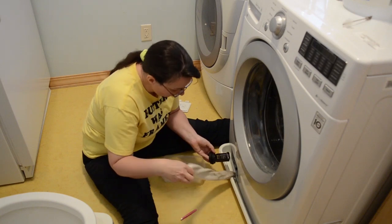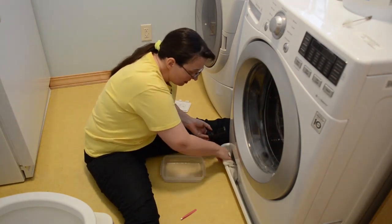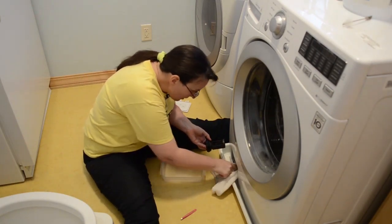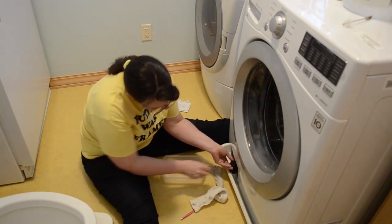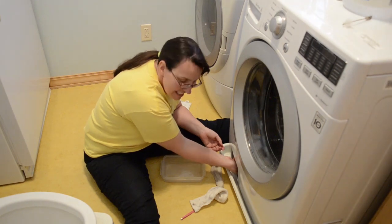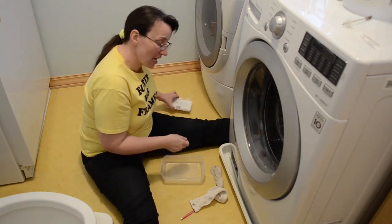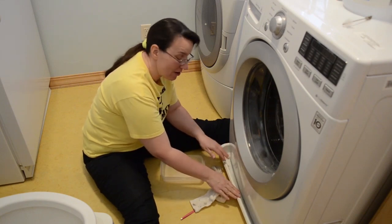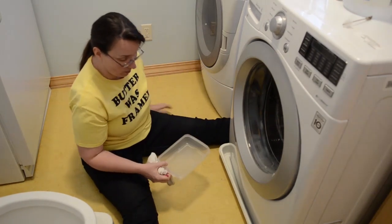The worst of it is off. You want to catch a little rag here as you pull out the filter, because odds are there will be just a little bit of water retained in there which will want to run out when you pull the trap. When you put this drain trap back in, make sure it's snugly seated, just like you're putting on a gas cap. One time I cleaned it and didn't seat it properly, and the catch basin filled with water. I'm going to move back up top and run the cleaning cycle.